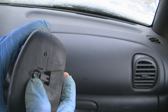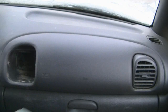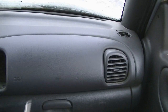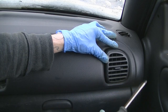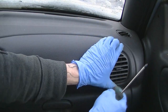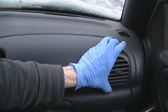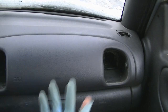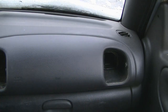These other vents are totally different for removing — they've got a centerpiece and a locking mechanism on them. I'll get that one out and show you how I did it. I started with a screwdriver, gently going in between it, moving it to one side to pop it out. Then pull the opposite way and it should pop right out — no damage to the dash. Vents out! Give those guys a wipe while I've got them out.